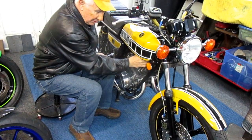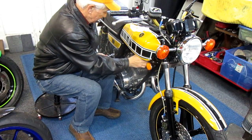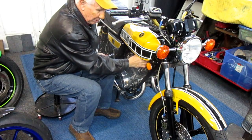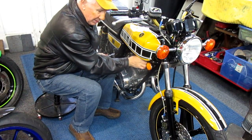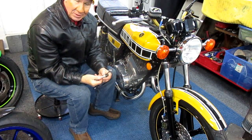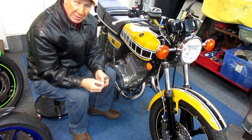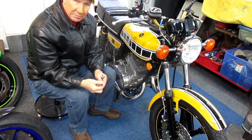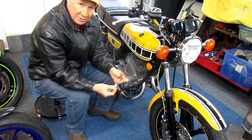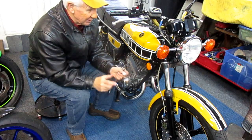I've had extremely good luck with this bike — 11,000 miles on it already with no issues with the spark plugs. I've used both NGK in the very beginning — a regular B8ES — and these Iridium plugs. The Iridium plugs are 10 bucks a piece but they seem to really hold up well. In the past with RDs and two-strokes you'd never go out on a ride without an extra set of plugs and a plug wrench, but this bike has been very unique — no fouled plugs.